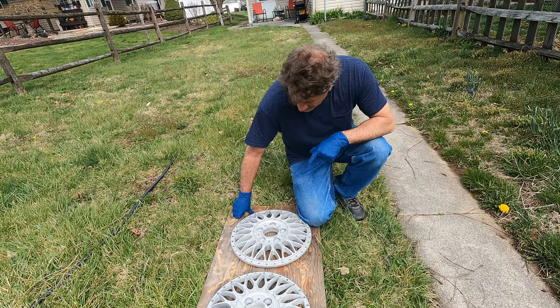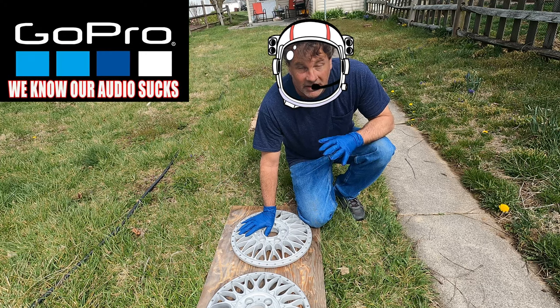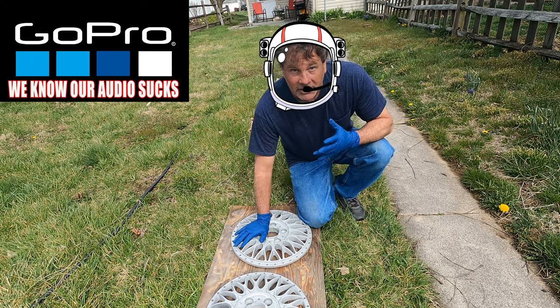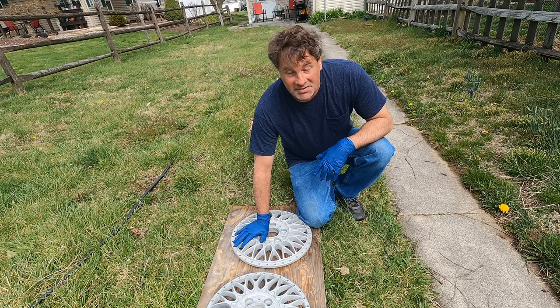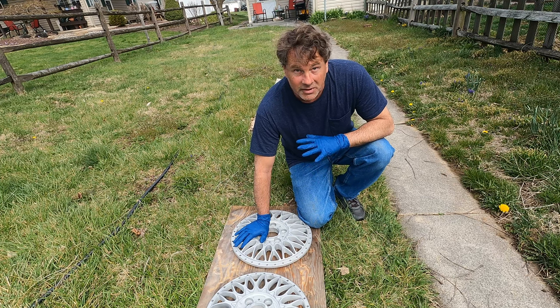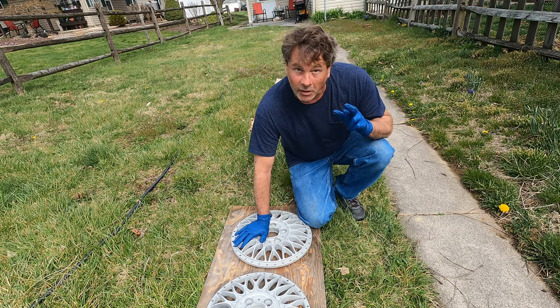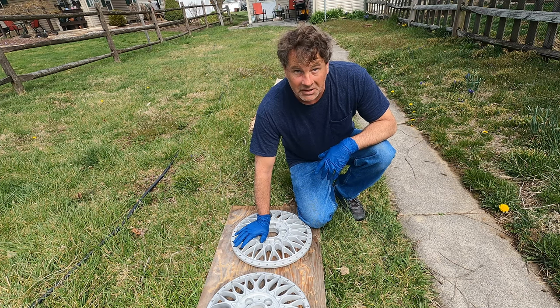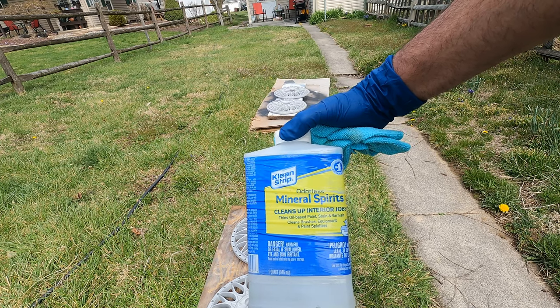Next, we've got our center caps, and we're going to make these go back to gold. When they get sandblasted they get turned to their original metal, and they end up kind of rough — the regular color of this stuff when it's rough is white. But by the end of today it's going to be gold. The process is basically the same as the barrels: hit this with a primer, then our paint. But in this case we're going to use a two-stage clear so these are durable and the paint lasts a long time. The first thing is to go ahead and use some mineral spirits and clean these all up, making sure there is nothing on here that paint isn't going to stick to.